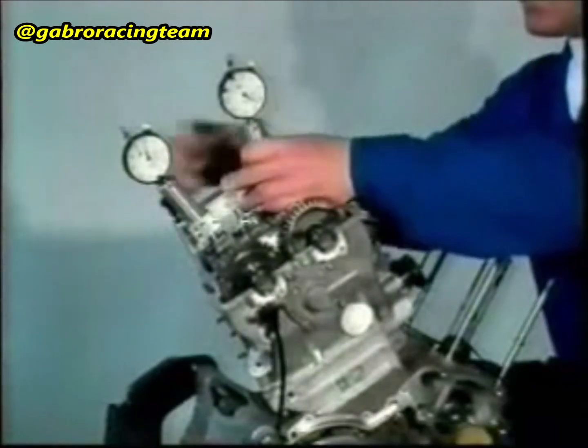Tighten the two screws with a 20 Nm tightening torque. Note, the quality of the M6 tube-headed screws is 12.9. Remove the special tools.